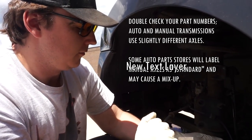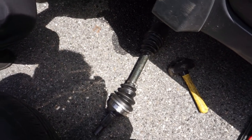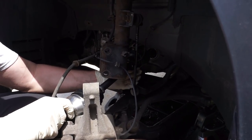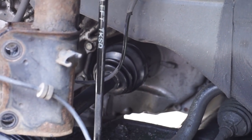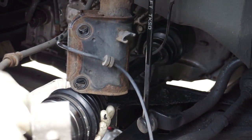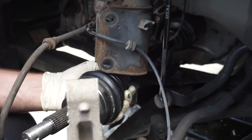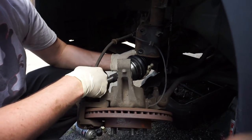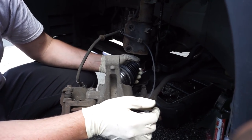We had received the wrong axle and now we have the correct axle. All you have to do is line it up perfectly, don't mess up the seal, and slip it into position. Then rock it back and forth — meaning front to rear of the car — and clip it right in. What that does is it allows the splines on the other end to engage with the differential. Once you've done that, take a little bit of grease and grease these splines so that it slips right into the spindle and hub assembly.